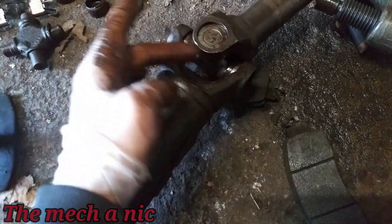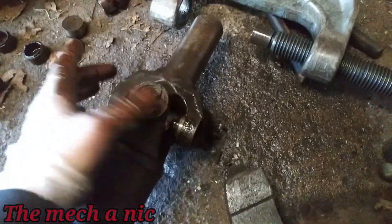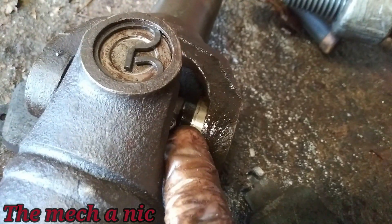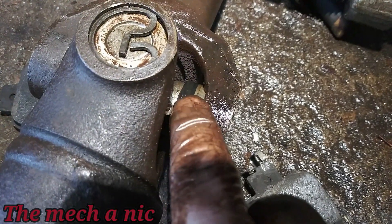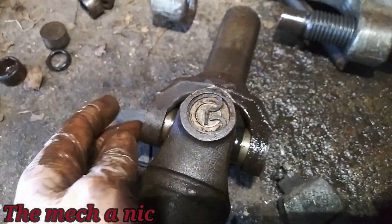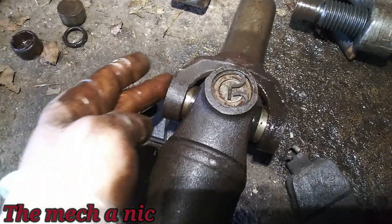The first side went smoothly, but when I was putting this piece on I got the clip on one side, and then when it came time to put the other side on it did not go in far enough to put the clip in. If you look at the piece of rubber right here, you can see how it's pretty much bottomed out against the U-joint — there's no gap. On the other side I actually had a gap about the thickness of a needle bearing. So I already knew what was going on — I had to take it back apart and sure enough there were like two needle bearings up against the cap.